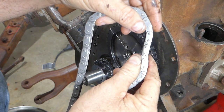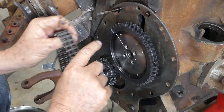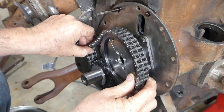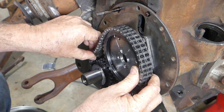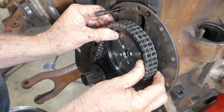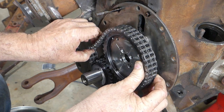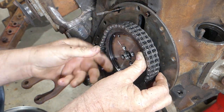I've got my chain assembled and I've got the little U-shaped locking collar set in the direction of rotation. Take note of where that was and try to get it exactly where you had it. We take that and this fella here — we might have to pick up a tooth or two just to get exactly where we need to be. We haven't turned the cam at all. That looks pretty close — yeah, not quite, pick up a touch.